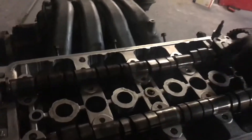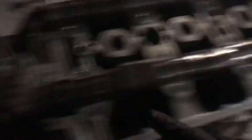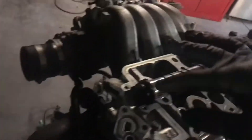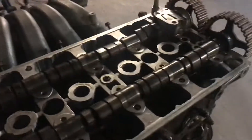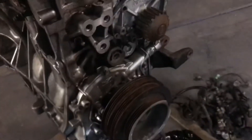There you go — the cams are in now. Starting to put the cam caps back on. We're gonna make sure we torque everything down. I got the new seals in there. So let's finish putting this back together. The only thing that's gonna be left is the dizzy, which I think he has in the car, but we're not gonna put that on right now. We got everything torqued down — making some progress. About to pop off the crank pulley on this one, then swap over the timing belt and water pump from the B16.